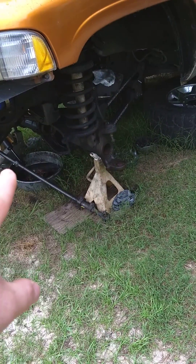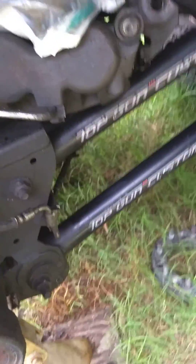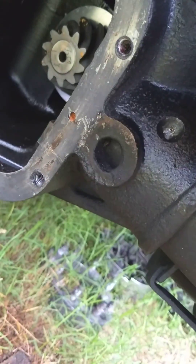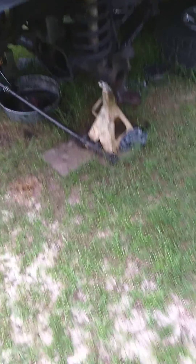Down in the truck, I needed to put seals in the axles already. I've got one for this side and one for the other side. Those are the axle tube seals that go kind of up in here behind that little hole there — it's back behind that casting, actually, where one of them goes and one on the other side. I've already knocked my old ones out.